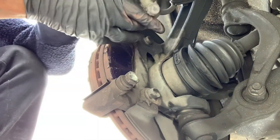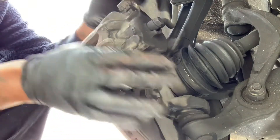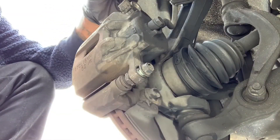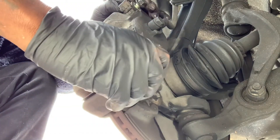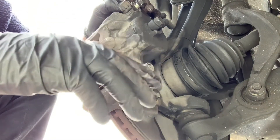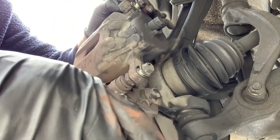I'm going to put the grease on and basically just slide this back on like that. Because I didn't change the brake pads it slides right back on very easily, but if I used new brake pads I would have had to use a C-clamp to push it in for it to fit. Since I didn't use new pads it goes right back in. All I'm gonna do is tighten these bolts up, turn the wheel back straight, put the wheel back on, and head to the next side. We're gonna go towards the spark plugs — since I'm just cleaning the brakes and not replacing them I'm gonna cut the video short and jump to the spark plugs. Thanks for watching — like, comment, subscribe.